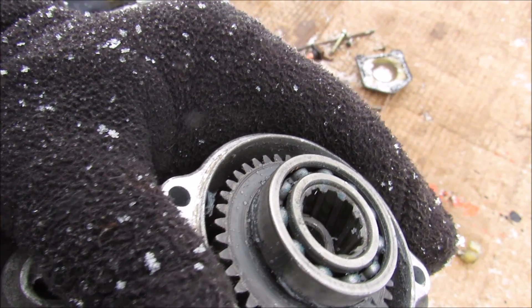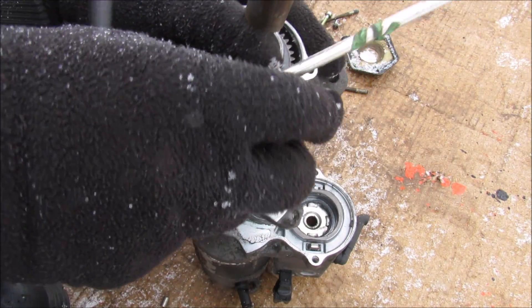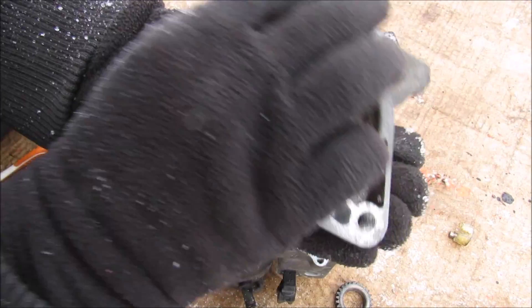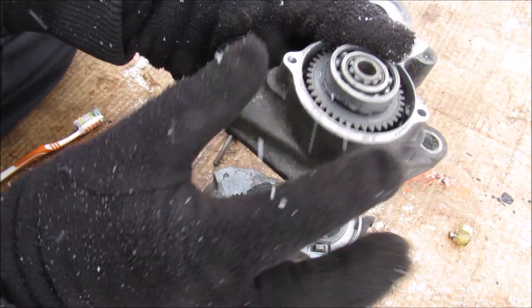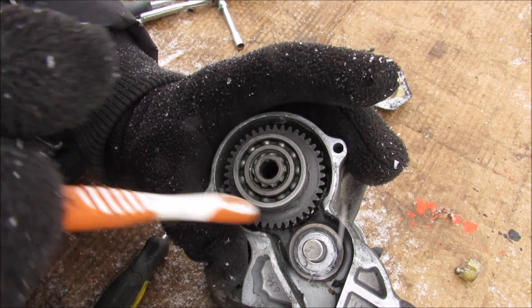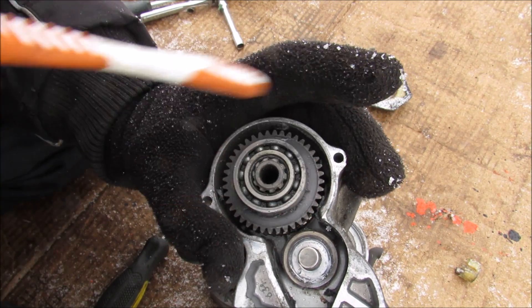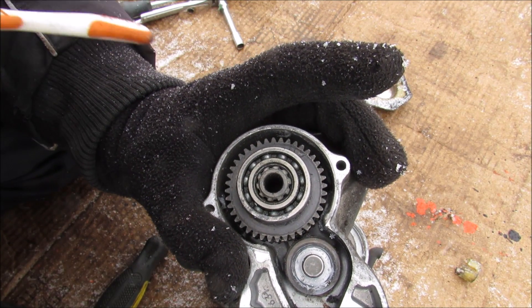If I move the drive gear outward you can have a closer look at that helical gear inside. If I remove this gear here you can see it looks like it's got a plastic inside and a gear on the outside. This plunger is actually pushing down on a little ball inside that sits inside of the shaft. This bearing is pressed onto this shaft so I can't open it up any further. There is some sort of a spring mechanism to return the drive wheel when the plunger releases. Also, some starters have a one-way clutch built in inside that only allows the starter to turn the engine in one direction.